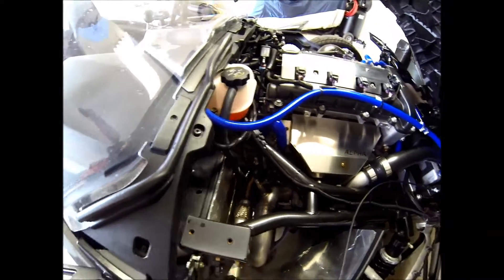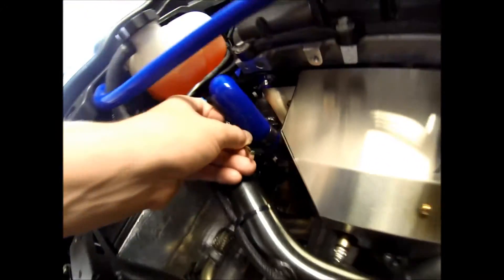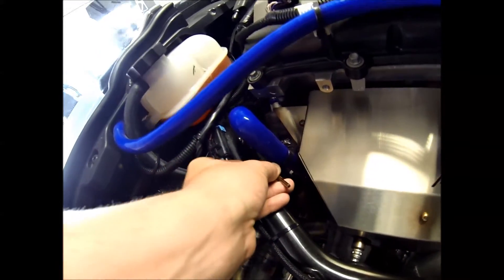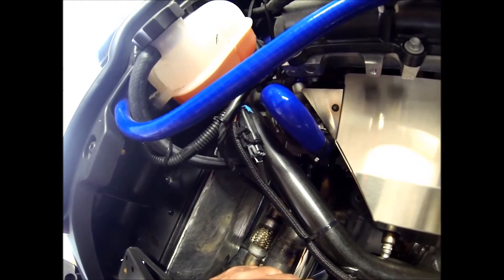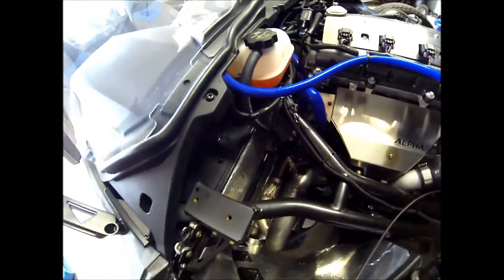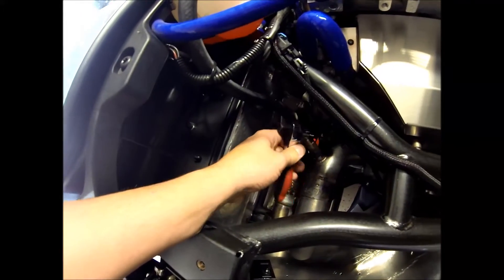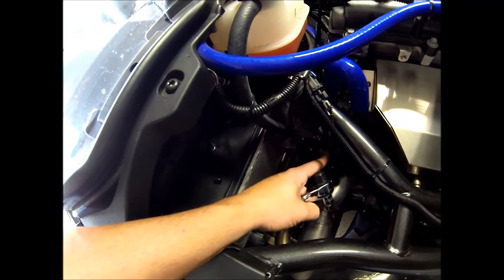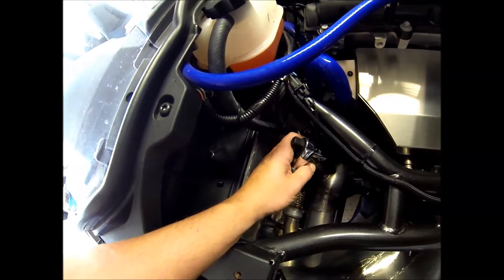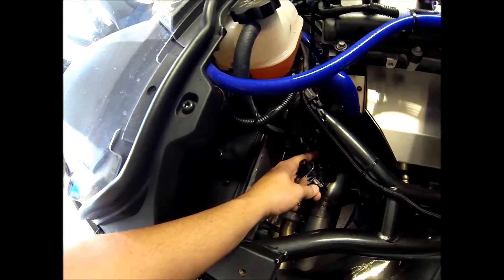Or you can possibly run a manual boost controller too. The one that's hard to get at — you're going to need this key — is this top bolt. That's where you use this key right here. Once you have about half a turn, you should be able to take it off with your fingers, making it pretty easy. This rounded four millimeter makes it really easy to get in here and loosen these up. Just remember that these are under pressure because of the springs, so when you get to the last bolt, it's going to want to hinge off or pop off — be careful that you don't wreck the diaphragm in there.